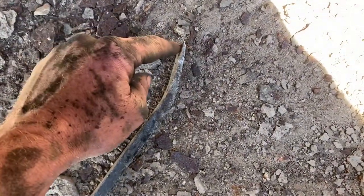I'm just going to use a pry bar. I have got a better bar but it's back at the workshop, I forgot it. What I have got back at the workshop is a bar like this but more of an angle on it, and then it's a welded bolt, a 6mm bolt coming out the end here, so it actually sits in that hole so you're not slipping off all the time. If you're doing quite a few of these, that's what you're going to do - weld the bolt, you bend the pry bar or something. But I'm going to struggle then, and I've got to be quick as well because I've got to pick the kids up soon.